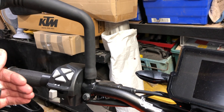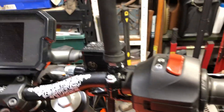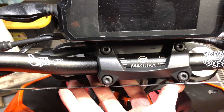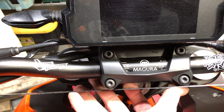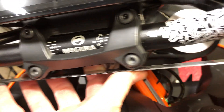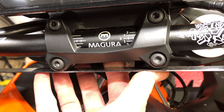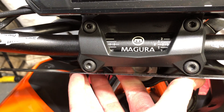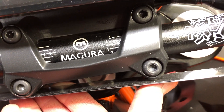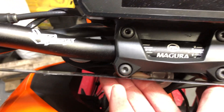So this handlebar will sit back half a centimetre more than the other one. What we should be able to do is sit a ruler across these clamps and it should be perfectly equal. But if I put this ruler flat against both and press at the top and the bottom, you can see how much distance there is. Those clamps are not square — this clamp is bent.